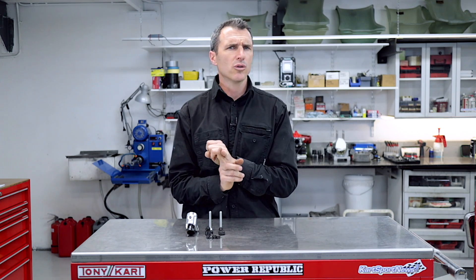Now we're ready to install the upper steering column bush. We don't want to force this on because sometimes the chrome has a little lip on the end of the steering column, and if you just jam it down onto our hardened steel bush it's going to make a big mess. So we just want to linish this back with a grinder so that it's a nice smooth fit over the shaft. Then slide the steering shaft bush on and just give it a little wiggle left and right — don't force it on, it should just slide on nicely.